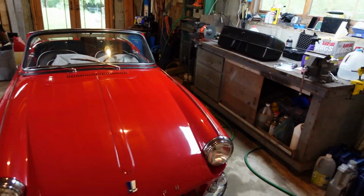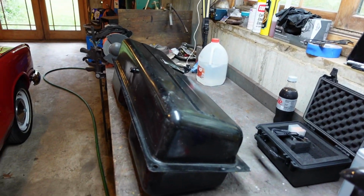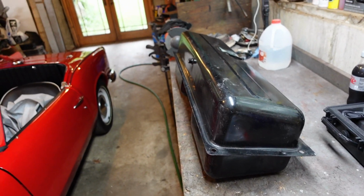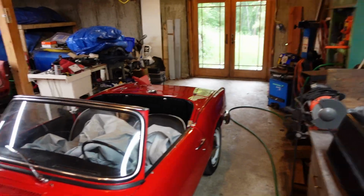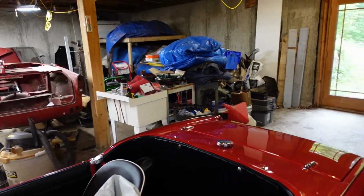So I'm going to go ahead and replace the tank because it's an original tank to the black car, so obviously it's got issues. I do have a brand new tank here that came with the car way back when I bought it. It's a reproduction, and it doesn't fit real well. I think one of the bolt holes doesn't line up, and the fill spout on it, which you can just barely see there, is not really aligned that well to the hole in the car. So when you put it in, the fuel filler nozzle's all crooked and everything.